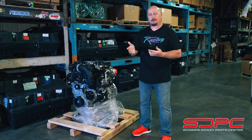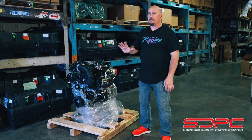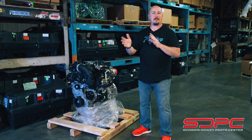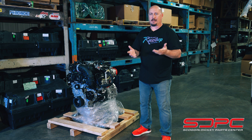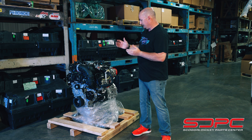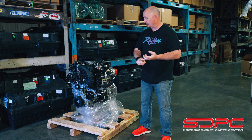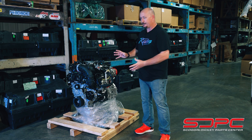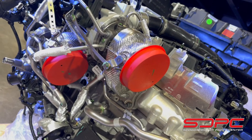The big thing is this setup really doesn't look like it's being leaned on. The turbo options are actually really close to a Garrett GT2871. For those who've followed the Garrett lineup over the past few decades, you might remember the Garrett Disco Potato — a very well-proven turbocharger for motorsports. This is a continuation of that. It's neat packaging, and it actually has twin turbos: a clockwise and counterclockwise rotating setup, which allows them to package it really tight.